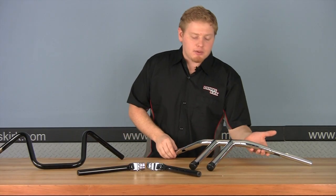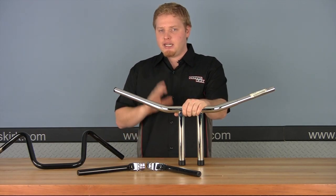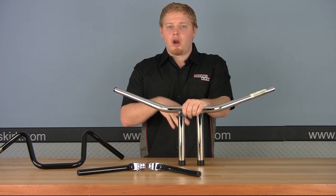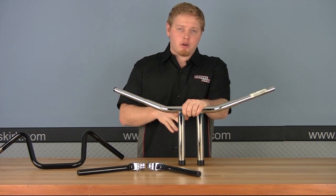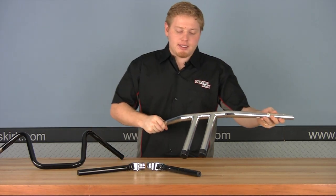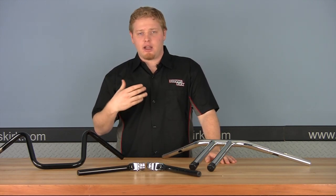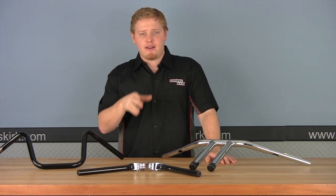When ordering from the Dennis Kirk website, especially for T-bars, make sure you search by make, model, and year. This ensures the mounting holes line up exactly — most are three to three-and-a-half inches across, but others can be up to five inches depending on the make, model, and ride. Also keep in mind there are many other styles of bars — broomstick, drag bars, clubman, aceman, ace bars — so make sure you browse for the exact look and feel you want.